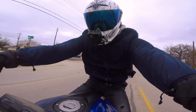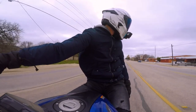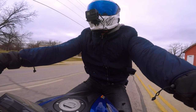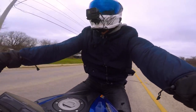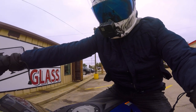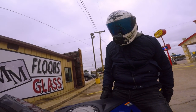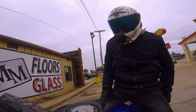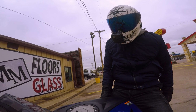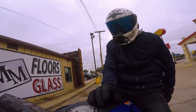All three of them looked over right at me once I killed it — this thing's loud. I don't know if a cop is behind me with that. We're going to have to ticket you for aggressive acceleration. I've never been stopped for that but I know it can happen. One thing you always want to remember when you have an idle adjuster is always put it back down to your stock idle — always — because if you don't, you're going to mess up your air-fuel ratio. Keep it below two grand at the very least. Between one and two thousand RPM, you should be good.